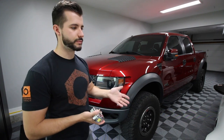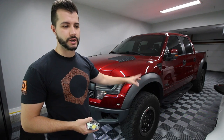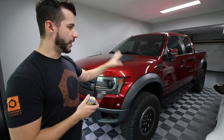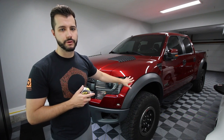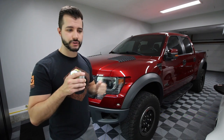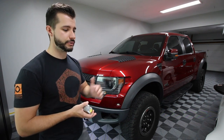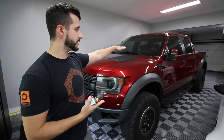So I went with TSW — again, not a sponsor, but they have really good support and everyone likes them, and so far really good service. A couple of the things I did change — I kept it pretty simple because this is a street-driven truck mainly. I did the mid-perch mount, which is definitely one of the most notable items. It's an extra 60 bucks for them to adjust to the mid-perch. Combined with the new shocks, this thing handles significantly different. The nosedive is absolutely at a minimum. It's not stiff up front. If you're considering doing mid-perch, whether you are rebuilding or not, definitely do it.